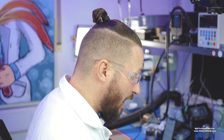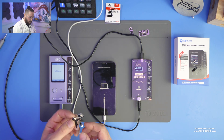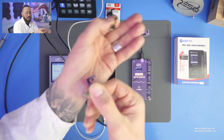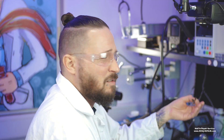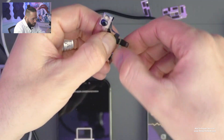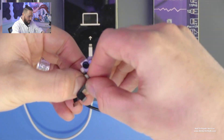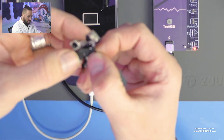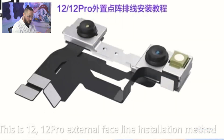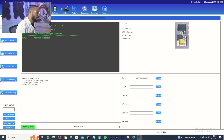After activating the chip, we start folding the cable — and that's easy. Compared to the Mijing flex, where you need to be an origami master, here it's just: bend one time here, bend here, and we're done. Connect the tag-on flex to the original dot projector. I'll also show the animation video because it's really easy — just bend it at that point, and we're done. Click 'Quit Recovery', goodbye, and the device will reboot.